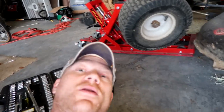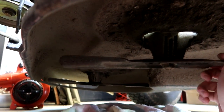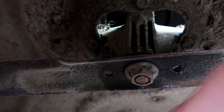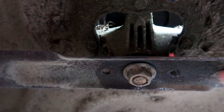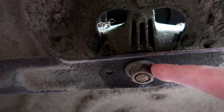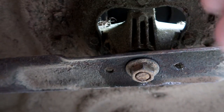As you can see, this lawn mower has two blades — one right here and the other one right there. If you look at the center of each blade there's going to be one nut. All you'll need to do is remove this nut, drop the blade down, replace with the new blade, and tighten it back on.